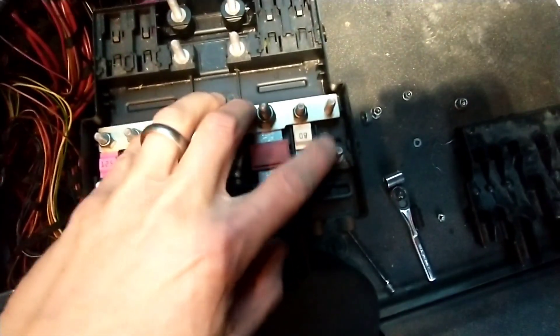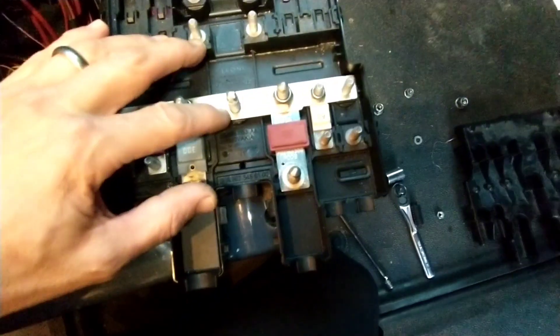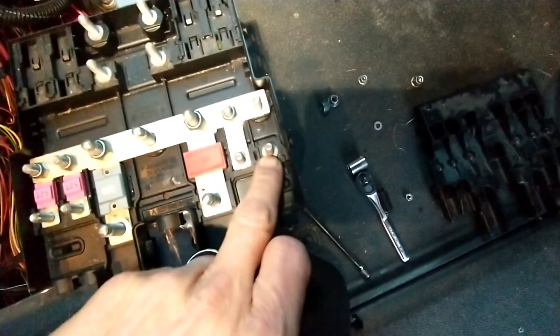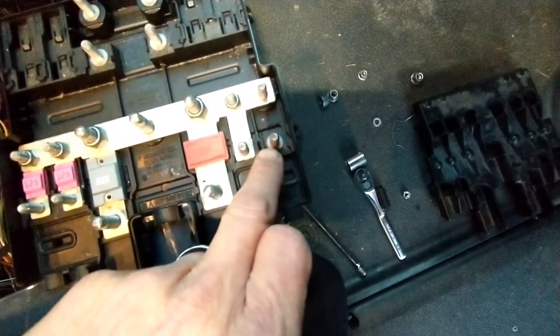You've got a midi fuse. You can see this open slot right here on this existing bus bar. There are other options — you could jumper to one of these guys with a homemade bus bar and then use a midi fuse over here, or lots of options to connect. But in this case, I can just put another 80-amp midi fuse for my 60-amp DC to DC right here.